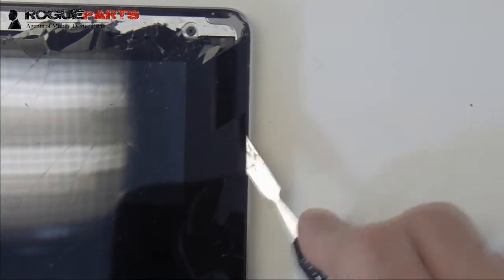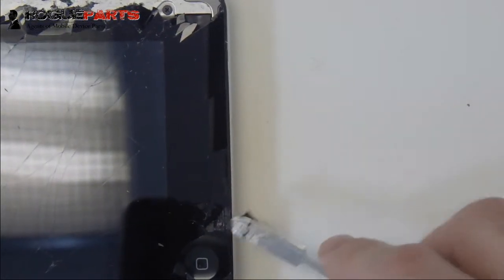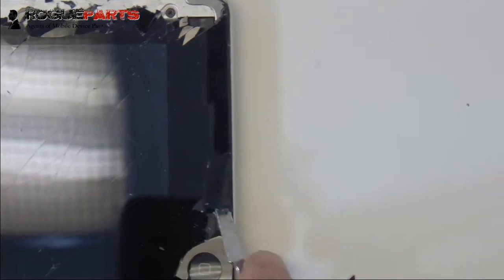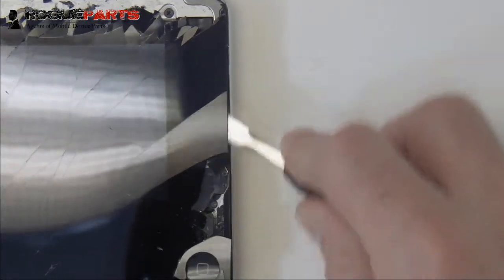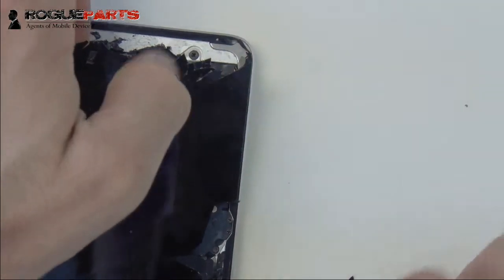We got some cracks around the area. We're going to stop right there, and we're going to come from the other side, essentially to the left of that Wi-Fi antenna, so we can move the spudger right, so that we'll be over that antenna rather than under the antenna, which could cause it to rip. We just exposed a little bit of the antenna right there, so now we can see exactly where we are. We have a visual point reference from where we can work.